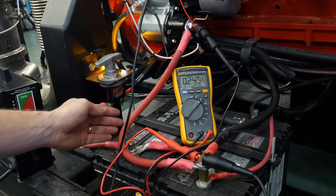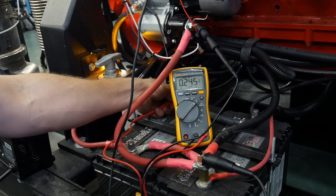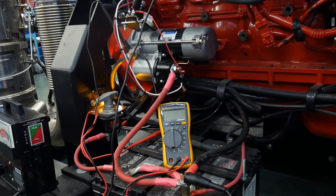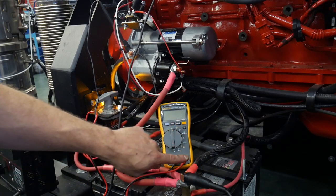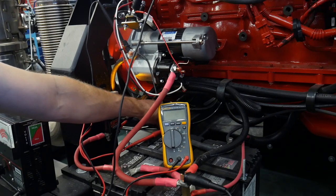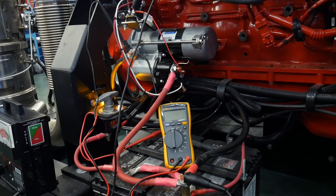That's quite something because this is a very short cable of a very large gauge. Now I'll move my lead — I'm going to take it off the positive side and put it on the negative lead of our starter. I moved the voltmeter leads to one end of the negative cable — the black cable going to the ground terminal of the starter — and the other lead goes to the negative terminal of the batteries.